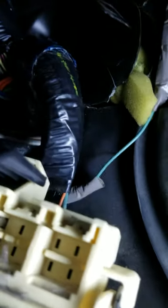I don't want to mess with that or cut any of those wires - those are important. So if you drill right on that dimple I showed you on the other side of the firewall, it comes out right here and you're golden.